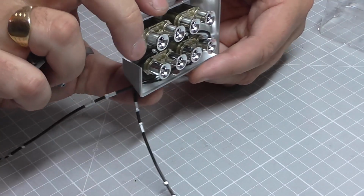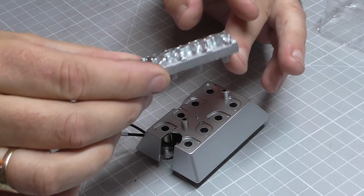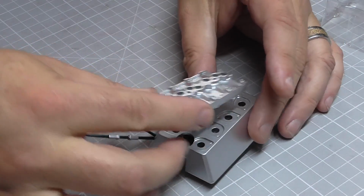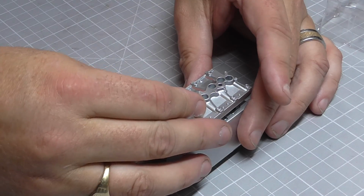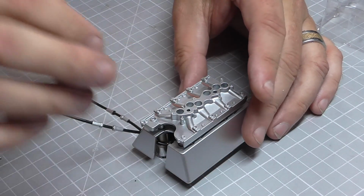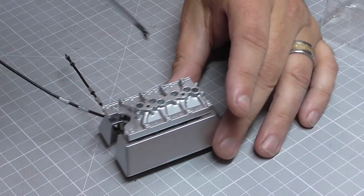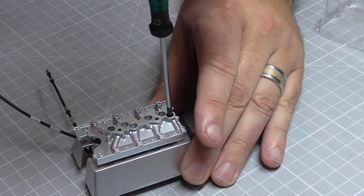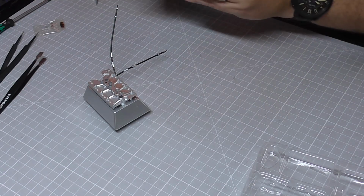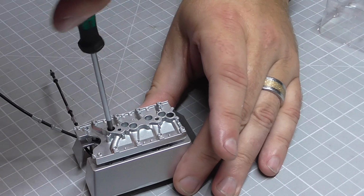We just want to then turn this whole assembly over and put the intake manifold on, which looks like that. That's just going to go over the top of this section here. Get that locked in. There you go. That's held in with FP01 screws. And they're just into these 2 points just here. So 1 here. Excellent. And then just 1 down this side here.